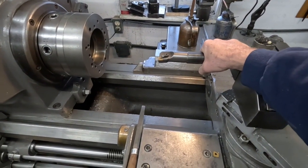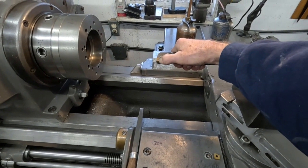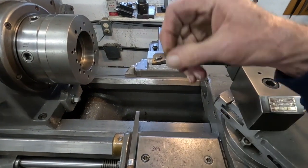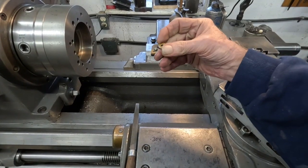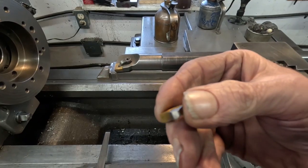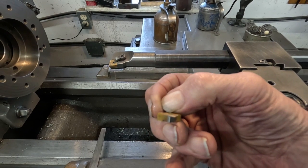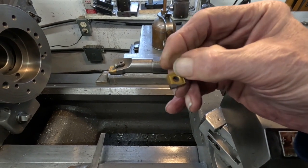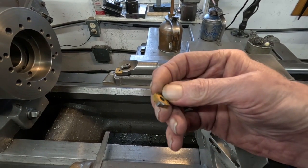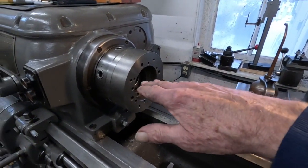You need a heavy bar, and most heavy bars use negative rake inserts. Here's a CNMG 432 half-inch inner circle. You can take a used one and go across it with a grinder — turn it into a positive rake insert with not much of a nose radius on it. It becomes deadly sharp. You've got to have sharp tools, and then you can bore the cast iron out.